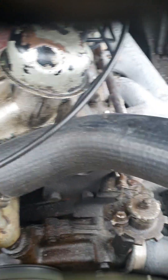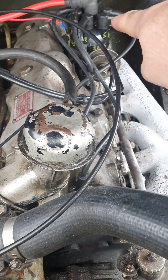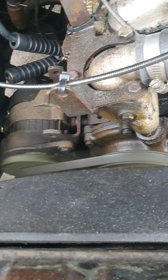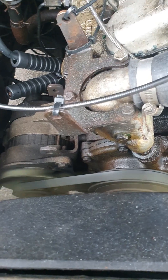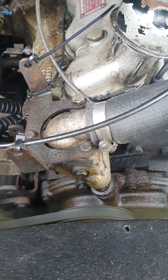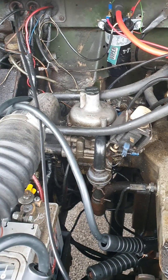Once you've got your ignition sorted, the next best thing to do is check the timing. I made marks on my pulley down there, and I set my timing by checking cylinder one top dead center, distributor set on cylinder one rotor which is over here, and then there's the fastening screw. You just adjust it a little bit to check your dwell, and once your dwell is set, you set your degrees before top dead center per thousand feet above mean sea level elevation. Where I am is 150 feet above sea level, so it's really just above zero degrees before top dead center — that's where I've got the car set. Once you've done all that, then you can start tuning your carburetor.